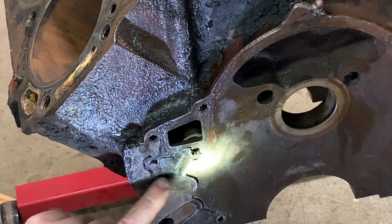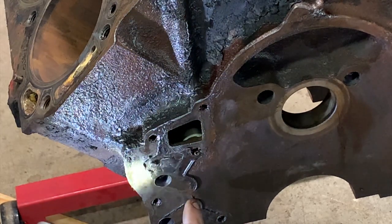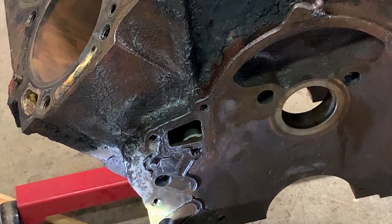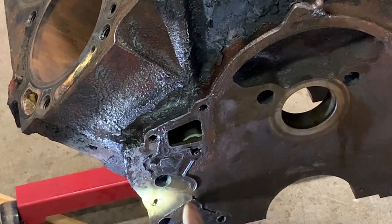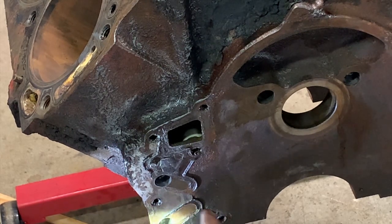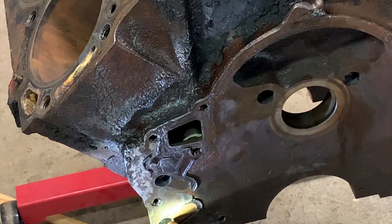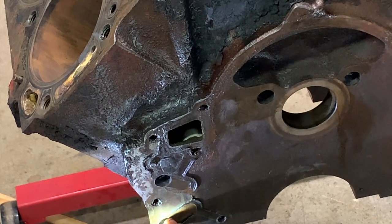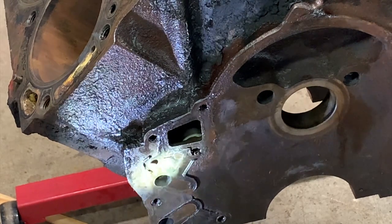The gasket gives you an indication of where the channel is in the passage, so you can bevel the turn and make it smoother — same thing here, because your pickup on your pump is right here and the output of your pump is right here. Generally, the best thing to do is bevel these so the oil can make the turn a lot easier. If you use a gasket from a later 1971-and-up Buick, the gasket is already opened up for a 5/8 pickup, and it will be overlaid a little further than the old gasket — it's not that much of a concern.